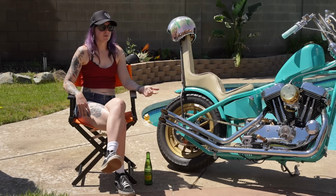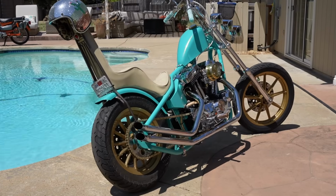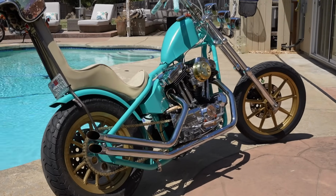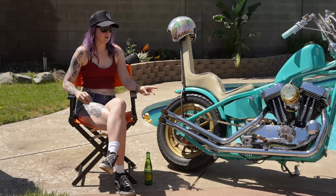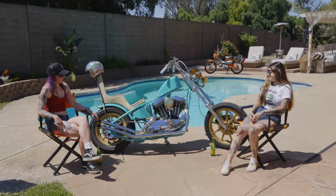He showed me how to relap the valves, so I relapped the valves. We replaced all the seals. Then we replaced the piston rings. The pistons were absolutely coated in carbon, so those had to be ultrasonic cleaned and all of that. Now they're nice and shiny, with new piston rings.